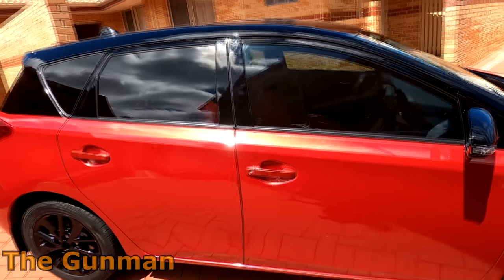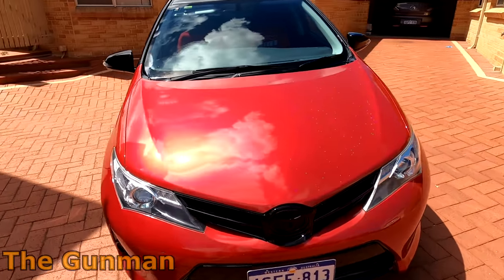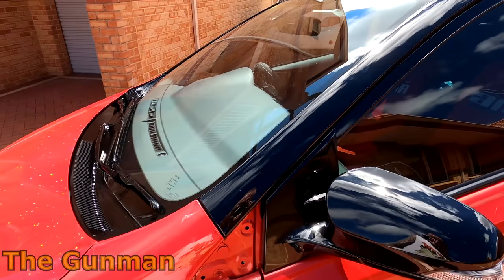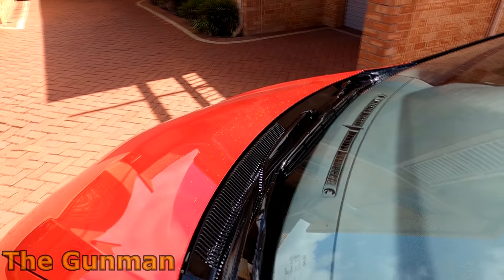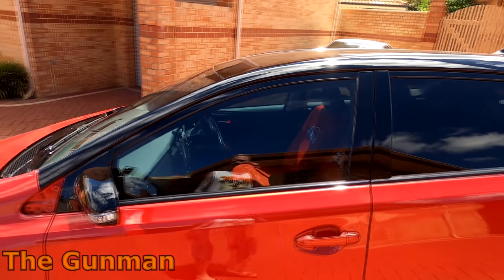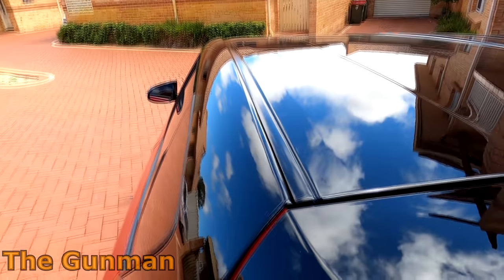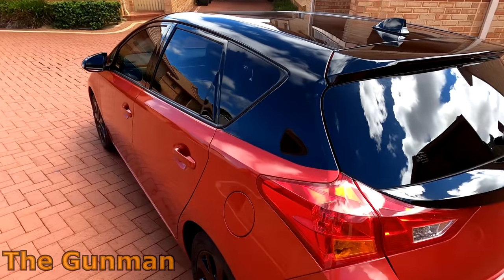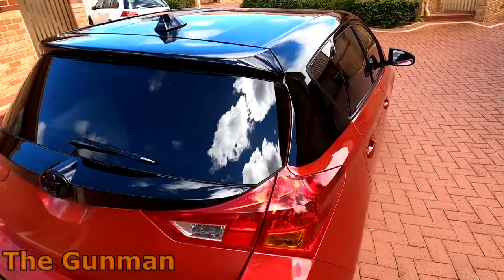I will actually be taking you guys through the rest of this job in future videos, so be sure to subscribe if you're not already. This is where we got the car to on that weekend — Friday morning spraying the primer, Saturday the paint, and what you see here is where I got to on the Sunday. There were a few little finishing touches still to do. Those roof gutter rail moldings were a really flexible plastic, or maybe even some sort of rubber. If I had gone two-pack clear over base on those, I reckon it would have started flaking.